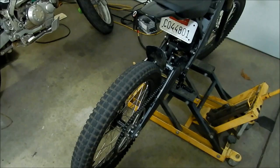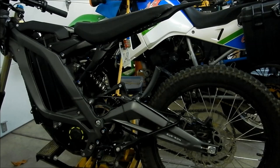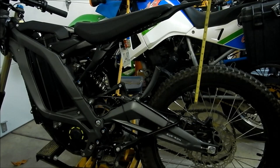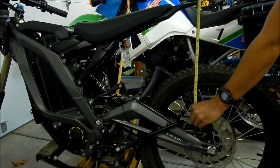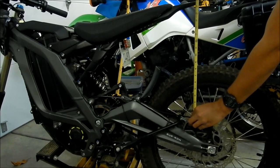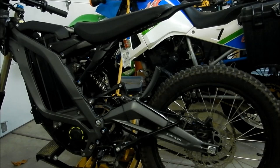I'm going to demonstrate taking the first measurement. I'll get the tape measure and measure from the bolt on the caliper to the tip of the fender, just letting it rest. Make sure you use the same measurement device every time and measure the same way. I'm reading from the side and I got 17 and a half inches. That is our fully rebounded measurement. Now it's time to put gear on, sit on the bike, and take the next measurement.